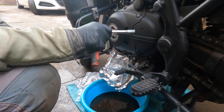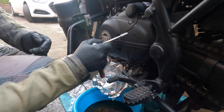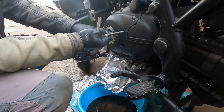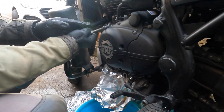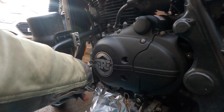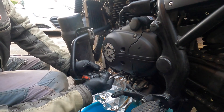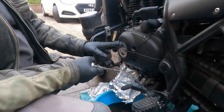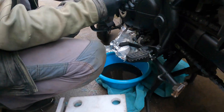While that's draining we might as well take these screws out — or loosen them off — so we can get the cover off. They go all the way around the circumference of the compartment. I don't think we need to take the chain guard off; it looks like it runs underneath so it should just be these all around here — they're all 8mm. These things should be quite loosely torqued really; it's only a cover, not load-bearing. Sometimes at the factory they're put on with electric drivers and can be a bit tight. I'll put the screws back into the same pattern they came off — they might all be the same length, but we're not going to risk it.